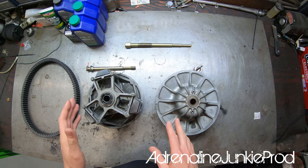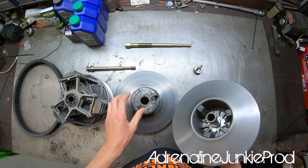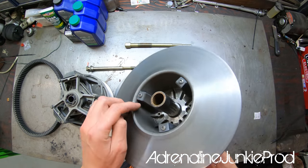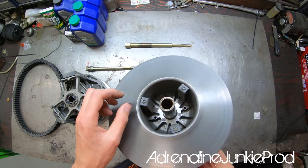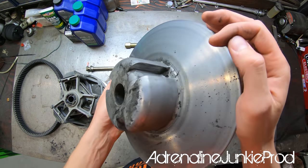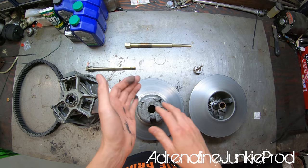We've got both clutches out — primary and secondary. The secondary slides apart really easily with three grooves and you can see a lot of belt wear debris in there. There are wear components on both sheaves that we'll be replacing. One side of the secondary shows a little aluminum wear worn into it, but it's not bad enough that I'm going to replace the secondary — that's expensive.